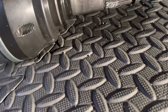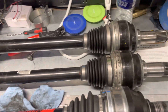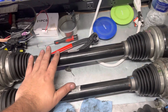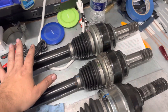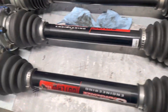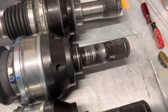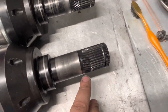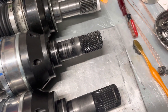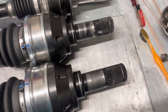I am really dissatisfied with this product — there is no reason these splines should be bent, period. These two are my old demon axles with about 200 to 300 passes on them; the splines look immaculate, not an issue at all. These are my outlaw axles — boots are good, nothing torn, splines on the hub are good — but the splines on the inner stubs are horrendous. This is the passenger side bent, this is the driver side bent. There is no excuse for G-Force — they should warranty all of this. These have only 15 passes on them. This is kind of ridiculous.